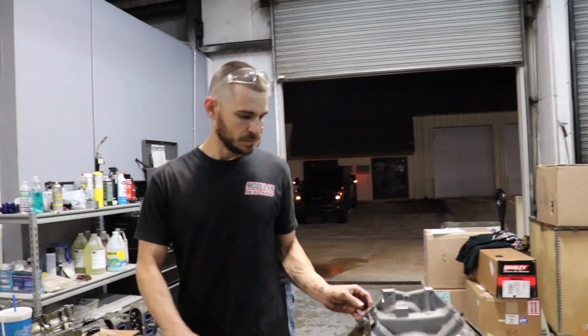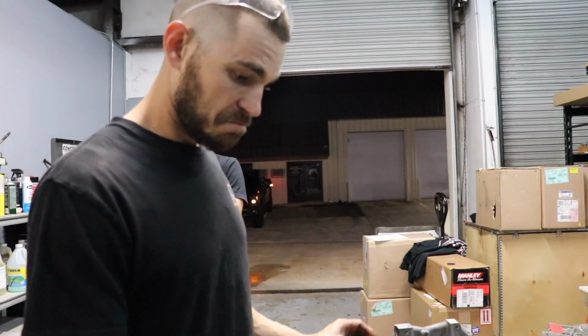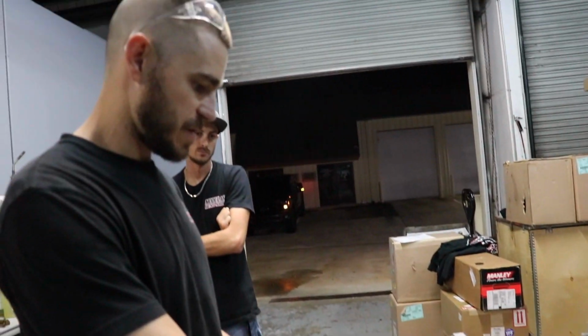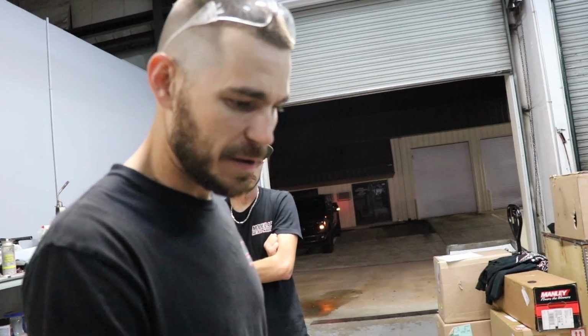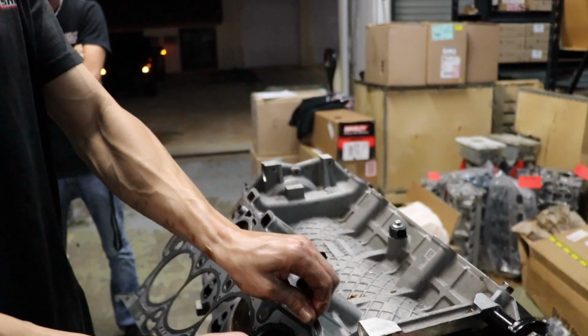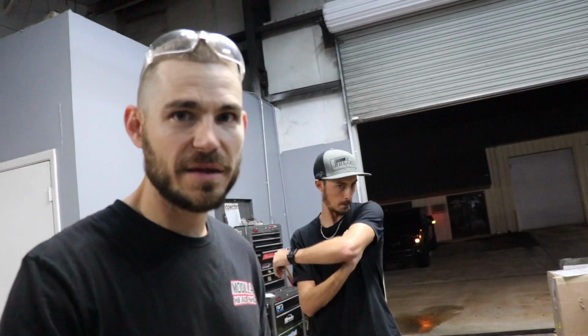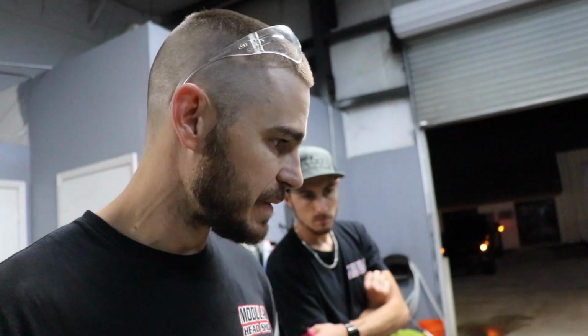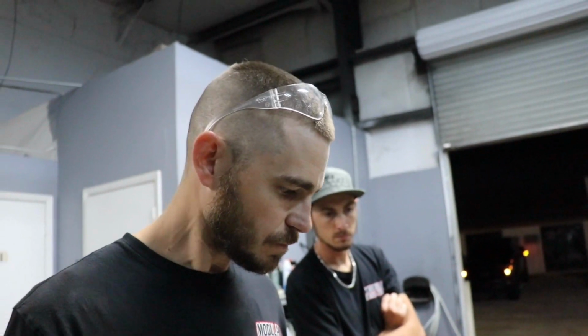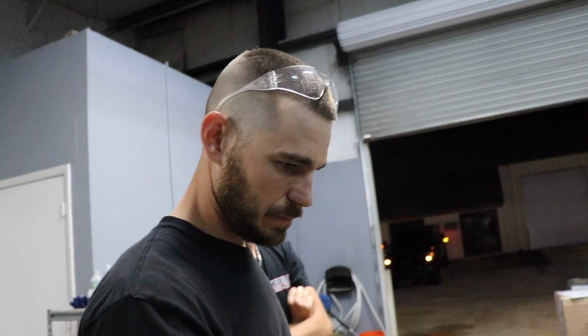All right. So what do you think, Jordan? Looks pretty decent, actually. I hope the aluminum isn't cracked in the block. We'll have to see there, but the piston is cocked sideways. The two intake valves, I could see just from looking down the port, were just barely bent. So you just see a little bit of light on the other side. Other than that, everything looks pretty good. Head gasket looks pretty good. Definitely in the right place to get some heads fixed up.